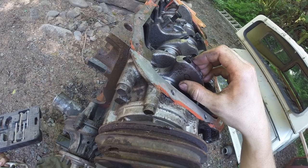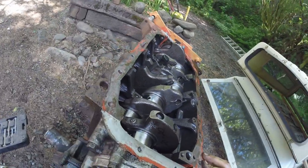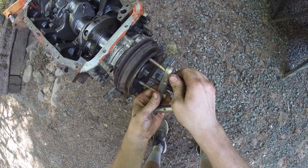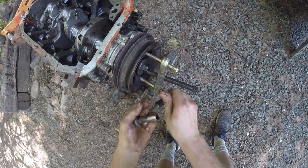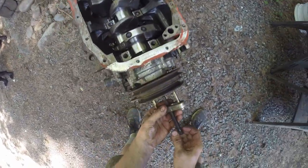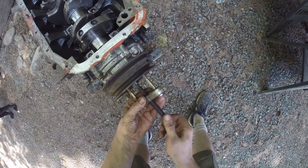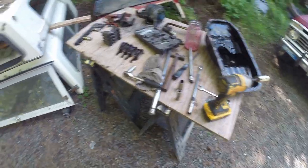The crank is 020 — 20 thousandths out. It says 20-20. That's good information — it means the shop actually probably did the machine work. If this was a much bigger pulley the puller wouldn't work. I had a hard time getting this same pulley off a Subaru engine I worked on recently, so we're just going to do it this way — safe, slow, and steady.